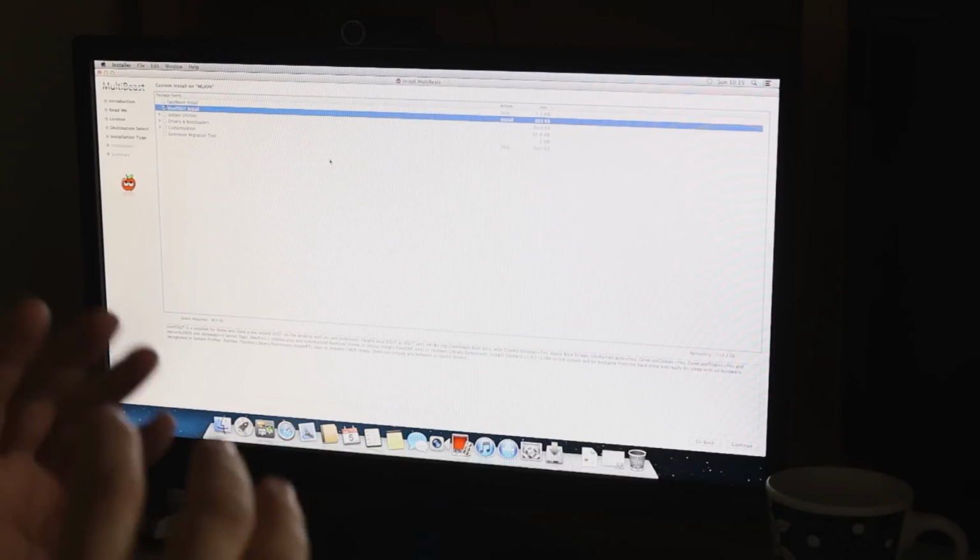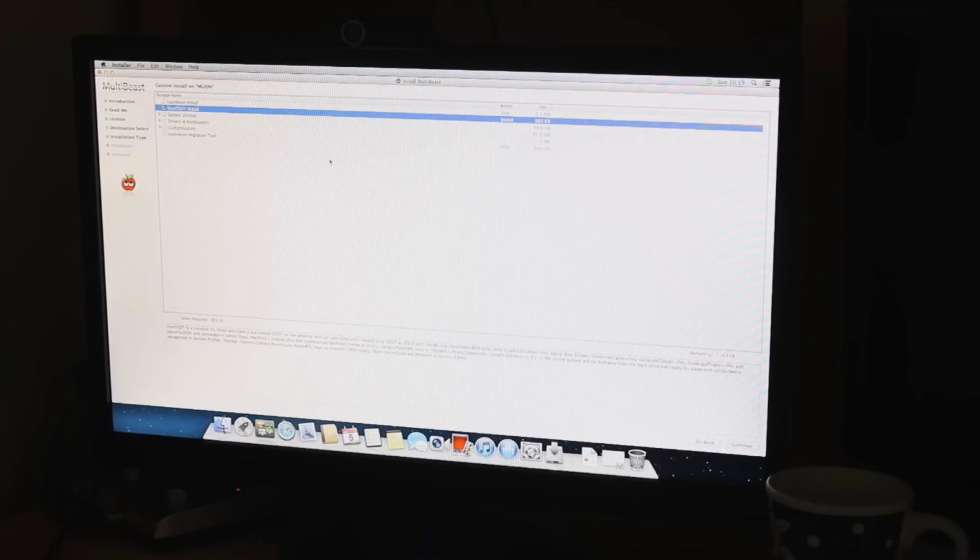Right, you see that jerkiness on that screen when I went like that? It's a bit better second time, but it just hesitated for that second. That's to do with your graphics power management. In Lion, I'll do another video on it, but that's what used to happen to me. Even though everything ran okay, it was a little bit jerky like that, because of the graphics power management hesitating in turning the stat up on your card. But anyway, so we've got user DSDT installed.